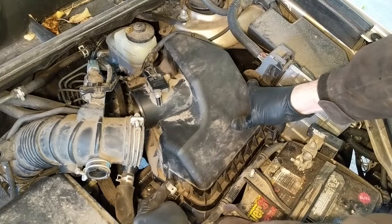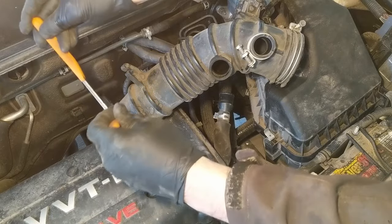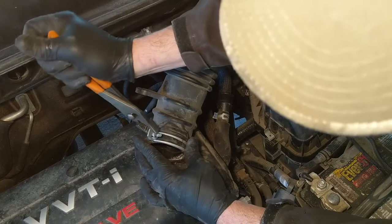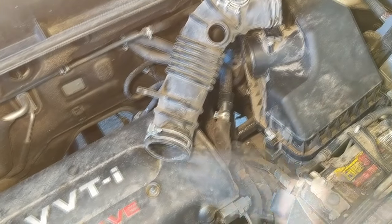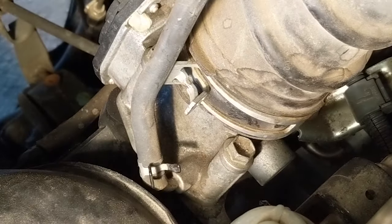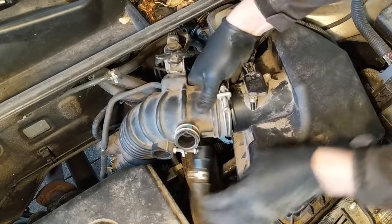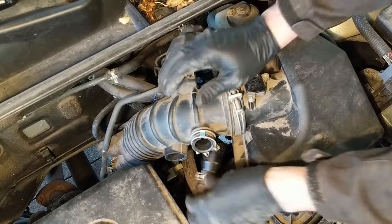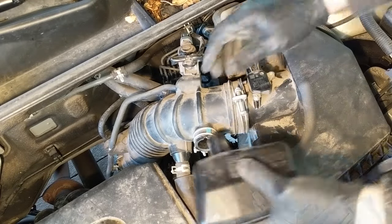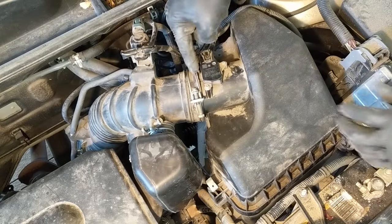Then it's reassembly after this. I'm not a big fan of these compression clamps, probably because I don't have the correct tool, but I was able to lock the clamp open so that I could get it easily over the throttle body again, and here I'm releasing the screwdriver. Just hooking everything back up where it goes, lining up things with their correct tabs and places, putting hoses back in. Here I'm reinstalling the resonator — basically a muffler for the air intake system to reduce the sucking noise of the engine drawing in air.